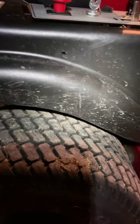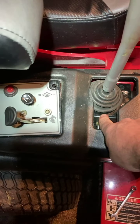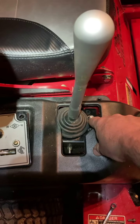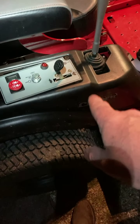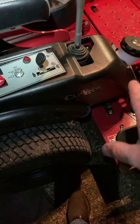So I get to looking, more and more things. The boot was not installed into the plate. The bolts were not tight at all. There was a 1/4 inch space in them. No washers on top of the slots, nuts underneath for spacers. Then you get into the linkages, and the lock nuts for the linkages weren't tight. And I mean, just on and on and on.